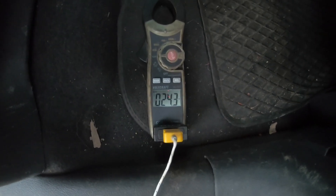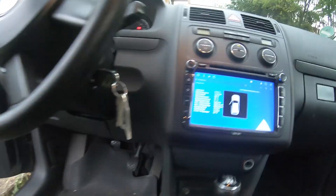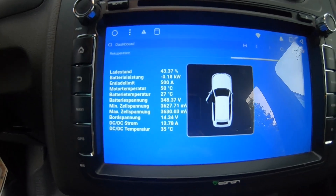We are back home. Cable temperature is back to a normal 24. Unfortunately battery temperature has just dropped by half a degree — okay, better than nothing. Cable tightening and cable choice is certainly important when rapid charging, because you've got this constant high amperage going into your battery, as opposed to driving where you only get short peaks and the average is pretty low. That's why professionals even clean the contact areas with alcohol and tighten their bolts to spec. It's quite important to look after that. I'm kind of angry at myself for not having done this properly when assembling the battery pack, but having to do it afterwards with hours of extra work to actually reach the bolt was tough. I'm quite happy with the result — there's no alarming smells anymore while charging and the cable heating is reduced.